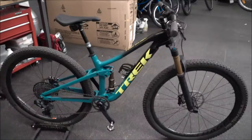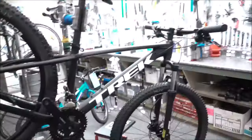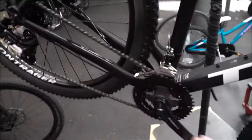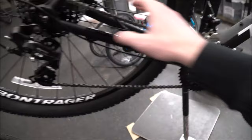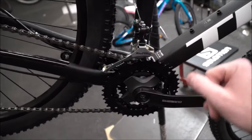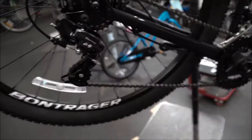So what exactly do you get when you buy a nearly $13,000 mountain bike in comparison to one which costs just a little around the $600 mark? With a $600 bike, you are going to get a nice, simple, basic Shimano style shifting unit. On this one, it is the Shimano Tourney, however you say it. And this one has a 3 chainring on the front and then a 7 on the back with a 6/7 derailleur. So this has a 12-speed extended range cassette.